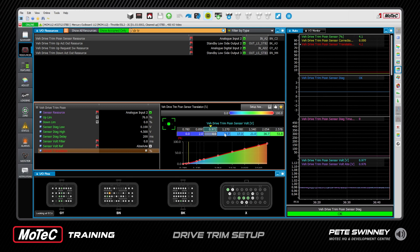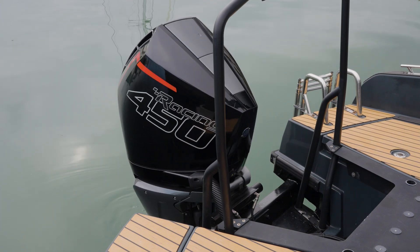If you want this to work well, just leave this factory calibration part alone and then do your fine-tuning of what the dash reads. The dash, like the fuel level, has its own setup for what you see on the dash for any given percentage of trim, back here at the ECU. So the process is: trim the engine right down.